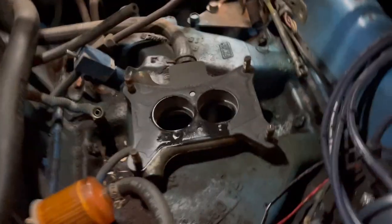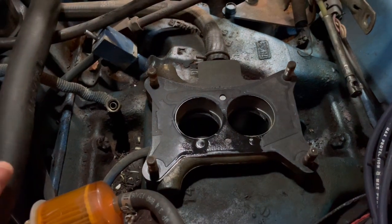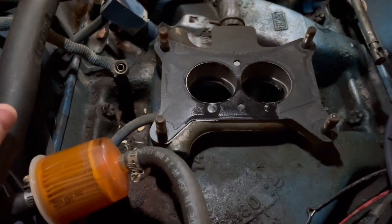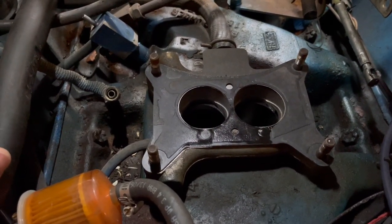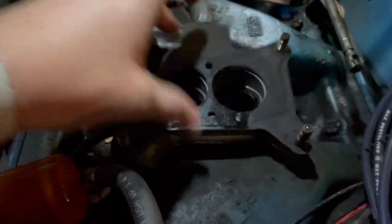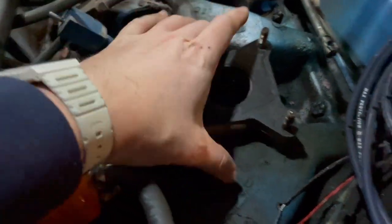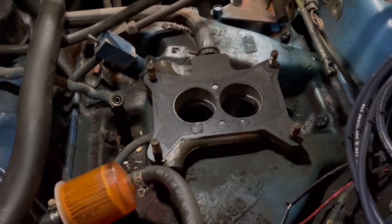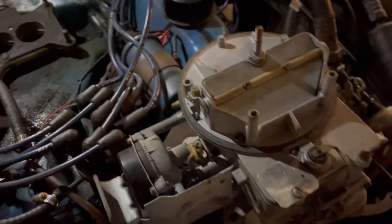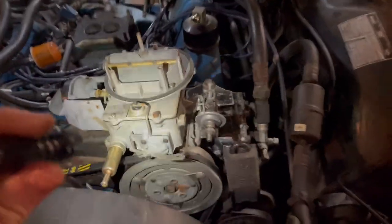You always want to put a cloth over the intake. We're going to put a new gasket on here — it's gasket, spacer, gasket, then the intake. You want to just check to see if you see any breaks or gaps in the gasket; that might be a clue to a drivability issue. This now just lifts off. This is a phenolic spacer underneath — or actually, somebody's put a metal spacer under here. In any event, there's a spacer between the intake; later ones on the four-barrels have a phenolic spacer. This one looks different, but there's the carburetor.